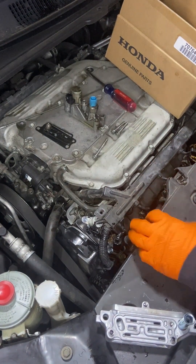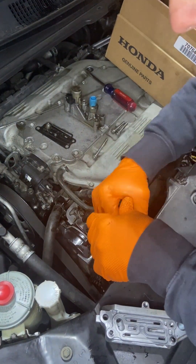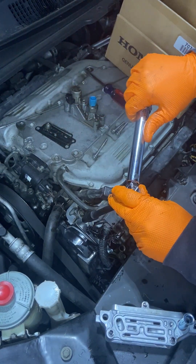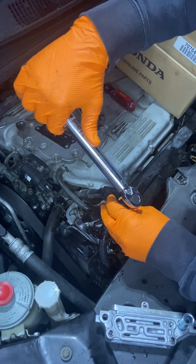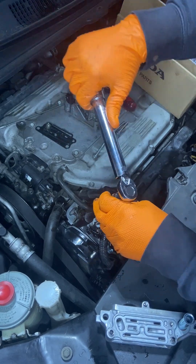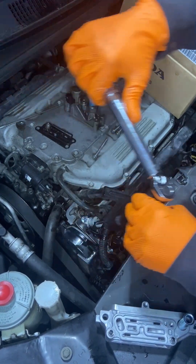Let's put these just snug first. It's really important to get the torque right on these. I think it's symmetric, so just kind of teeter-totter back and forth and get that 72 inch-pounds. It's not very tight — just snug. You don't want one tighter than others. Getting them symmetric is the most important thing.